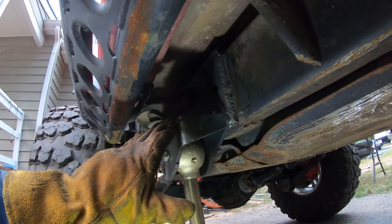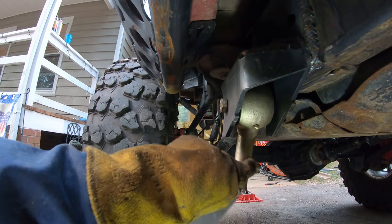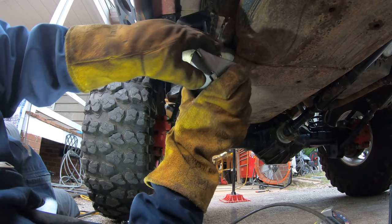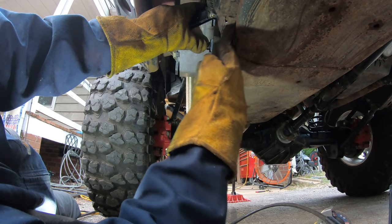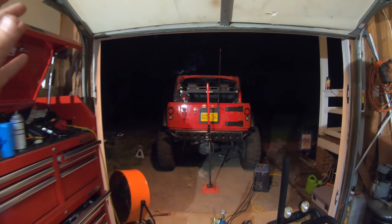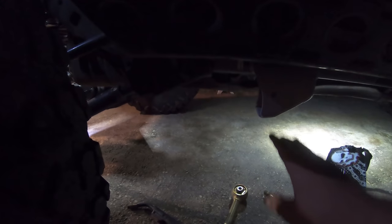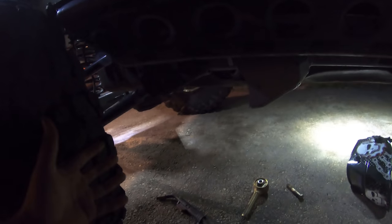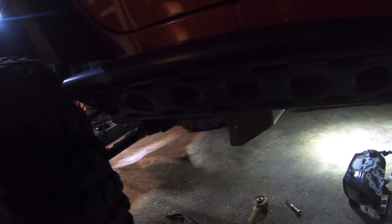With the plate welded in along both sides and the underside, we now put in the little skid plate bracket, add a joint so it doesn't shift around, and close the gap — it has a little curve that wraps around to the frame as well. I just finished the passenger-side lower control arm bracket and have it primed. As you can tell, it has about the same clearance as the factory control arm brackets. I know some of you are probably disappointed by that, but this is going to give us better ride and handling than moving it up.